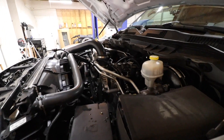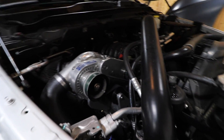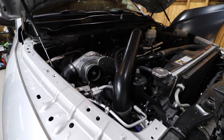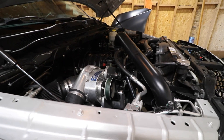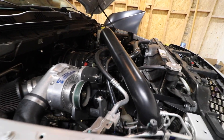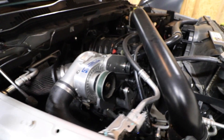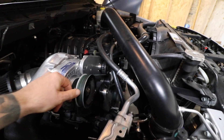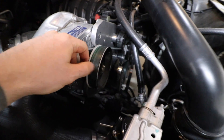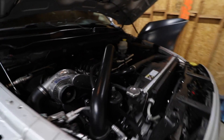I did want to mention this belt deterioration, which in the grand scheme of things isn't really that bad. If you had a brand new belt and weren't tracking it but just having fun, I'd guess you'd get a solid 5,000 miles out of a belt. This one seems to have about 3,500 miles and it's not yet toast — it's making noise, but it doesn't look too deteriorated. It's this gunk built up on the backside that I think is causing the squealing.